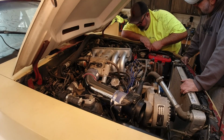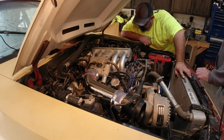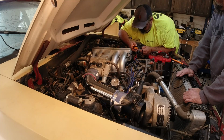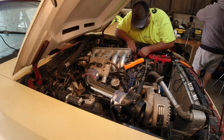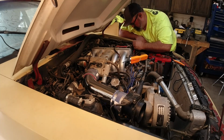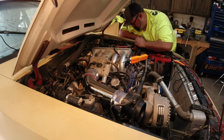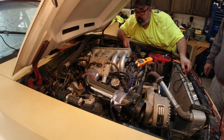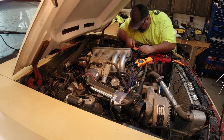This is corroded up. It's not making a good battery connection. Okay. Well, let's see your test probe, I guess. Click. Oopsie doopsie. Sandpaper instead, or is that good? I think this would be good enough for our purposes. Okay. I'm inclined to believe that starter solenoid's bad.